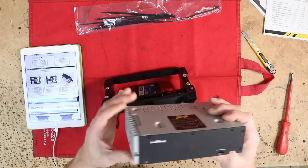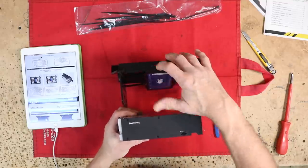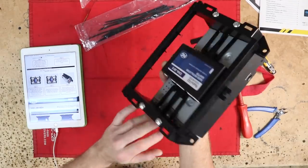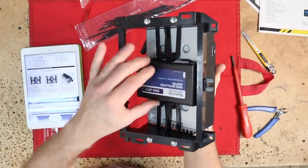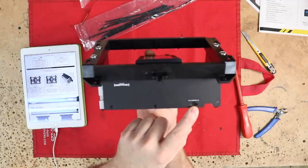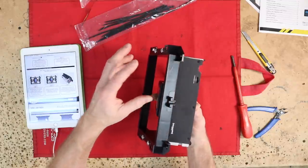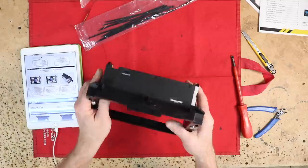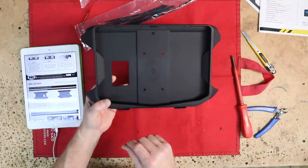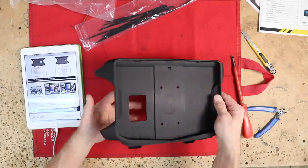With your main brain in hand, mount it with the harnesses located towards the bottom. The Sirius XM logo should be located up against the top corner. Use the four fine-thread screws from the parts bag. When the four screws are in, the main unit should be nice and tight. The GPS SD card is located in the back corner — note to self: if you're going to add GPS, do it before you install this into the car, not after. Grab your main mounting bracket for your build — in this case the Hi-10. Flip it over to the back, click all six orange clips into place, and set it aside.